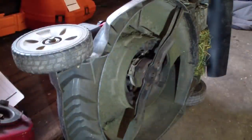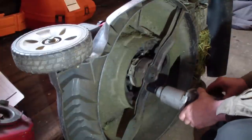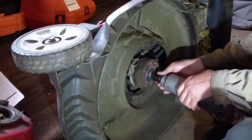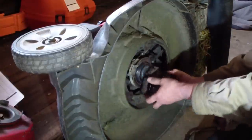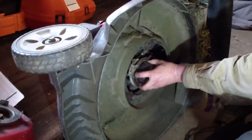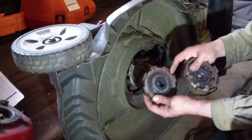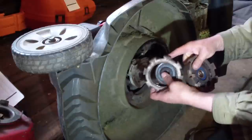So I'm going to do this blade clutch. You've got your clutch spring, your clutch, and your driving disc. And if you look, you can see that's worn, that's worn — it's been gouging into there, and that doesn't look too wholesome in itself.